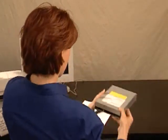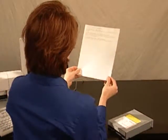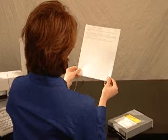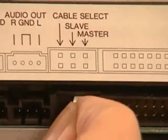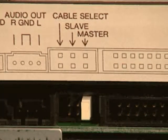Then, you will be setting the jumper on the back of CDWriter Plus. Look at the Install Recommendation printout. Under the heading Jumper setting, it should say that you will be using the master position. To move the jumper from the slave to the master position, grab the jumper with your fingers, pull it straight off of the set of pins labeled slave, and push it onto the set of pins labeled master.